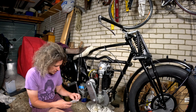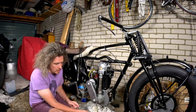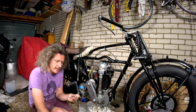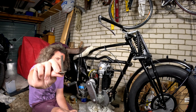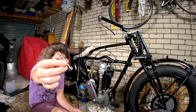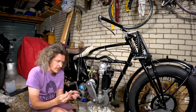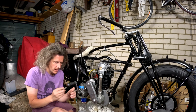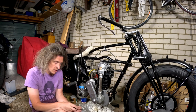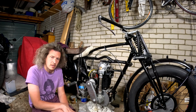Also purchased some bolts for the tank. Although I had the tank mounted the other day, this is the rubber system, so a big one on the top, small one on the bottom, and then these are the bolts that the employed engineer used. No good. It just screws up into the bottom of the tank. What you need is one of these with the shoulder shank, and then just stop there, so that as you bolt that up, it will stop and not go through the bottom of your tank, and yet the rubbers will still be able to do their thing. So I got myself 4 brand new ones of them. I did have 3 originals, but can't find them, plus I needed to make a 4th. So yeah, that's good. I'll get on with doing this clutch cable thing and then we'll carry on.